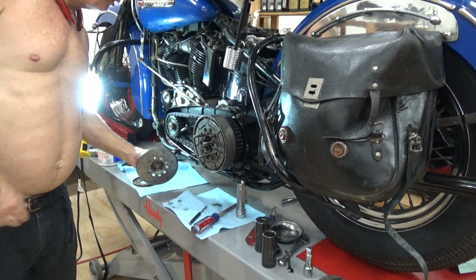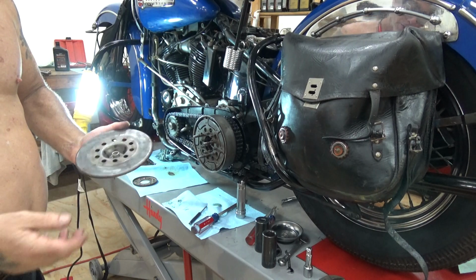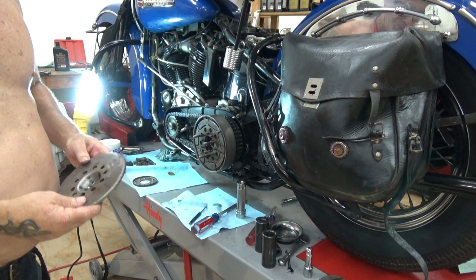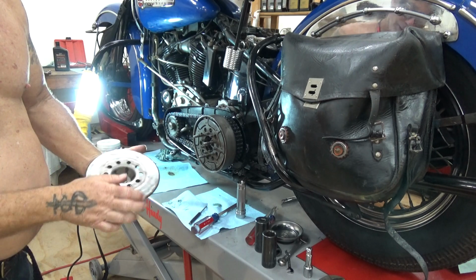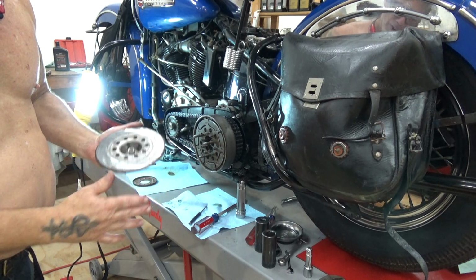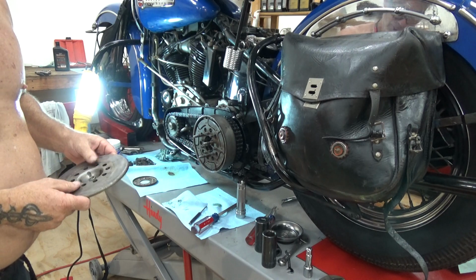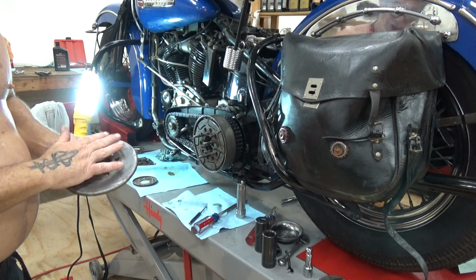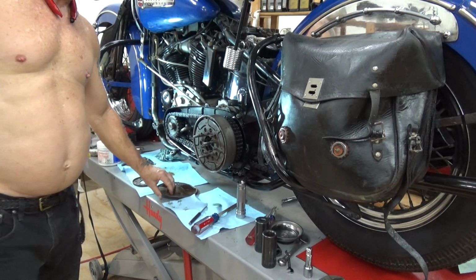Now, you will notice that I lightly took the, it gets burnished. That burnishes material and it doesn't grab properly. So, Scotch-Brite wheel again. If you don't have one, 1200 sandpaper, not 600 sandpaper, it'll scratch it. It's 1200 sandpaper. Just get the burnish off. It's almost like a polish.